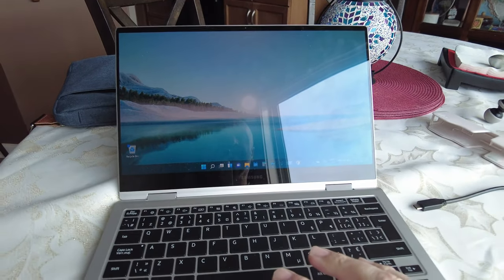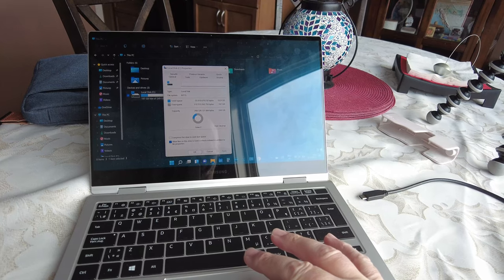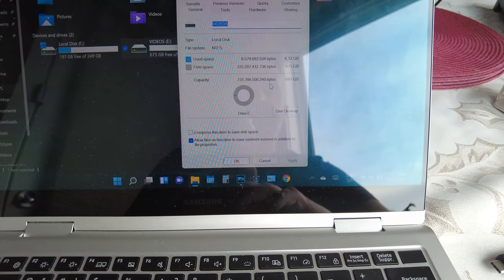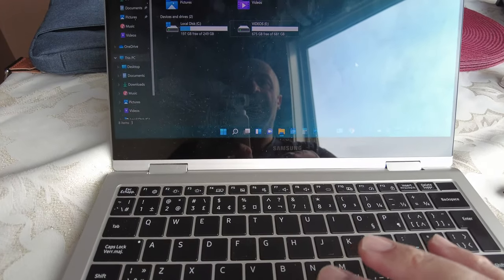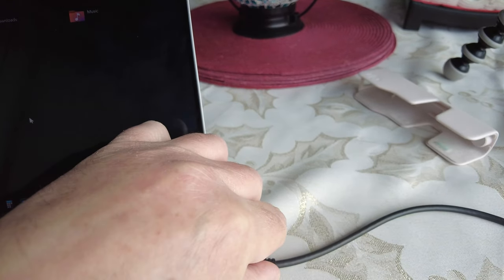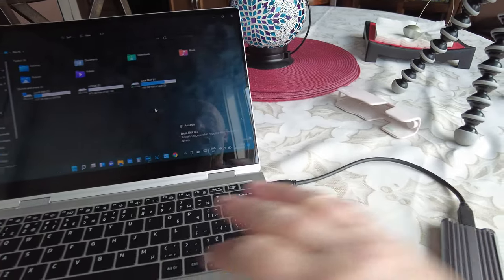Hello everyone. Day two. Back to swapping. So basically, finally I did it. So finally I have two different things. One partition and a second partition. In that second partition I have 681 gigabyte, 731 but 681. This is binary and this is decimal. Anyway, together it's 930 gigabyte or 1 terabyte, and the old drive I'm just gonna use, as you can see, it's gonna pop up and I want to demonstrate that everything works well.